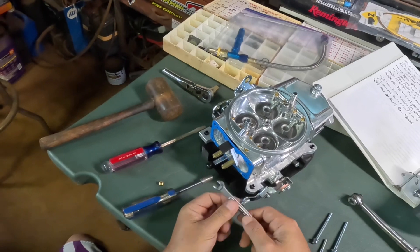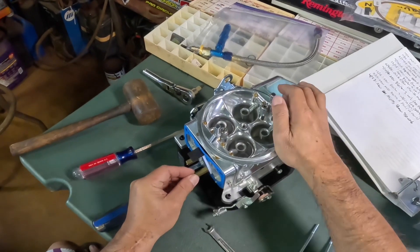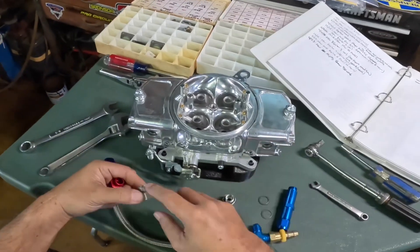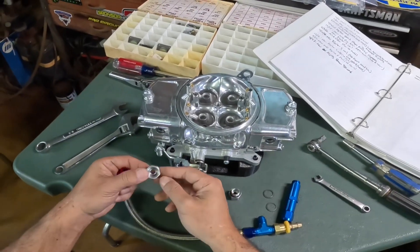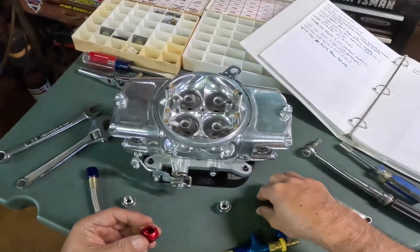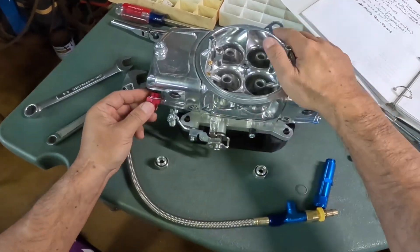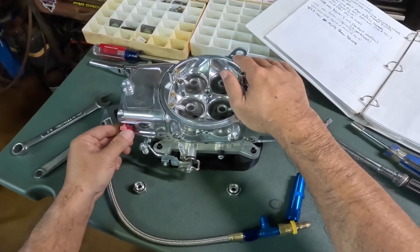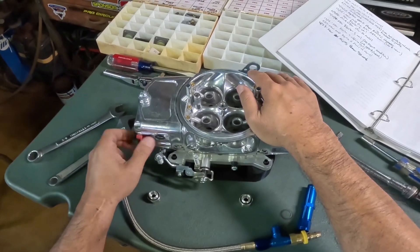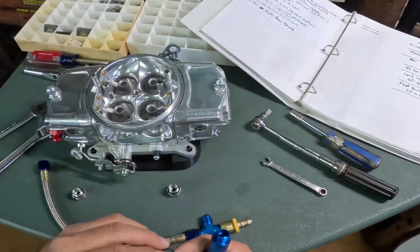You can hold it with a wrench — it's 8mm. Take out these and make sure you take out the gaskets. These are for if you run a different style fuel line. These have AN fittings. I don't have AN wrenches so I'm just going to snug them down.